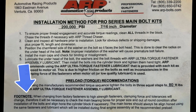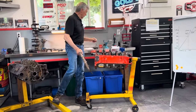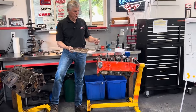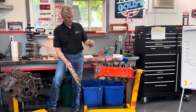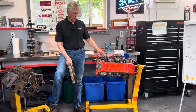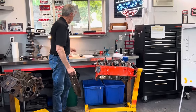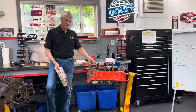That's what inspired me to do this video. This is a follow-up on Tony Guzzo's engine. I made a video before saying that the bolts Tony provided to locate the windage tray were too long. I tried to shorten them and extend the thread, but that weakened them, so I couldn't use them. So Tony bought an ARP stud kit. Following the belief that you need to recheck all clearances, I'd have to take the engine completely back apart — and I sure don't want to do that.